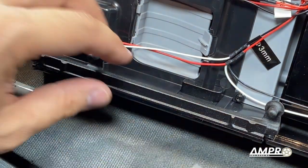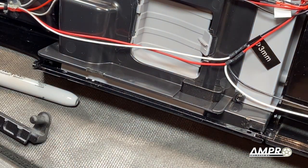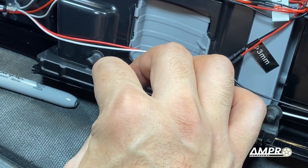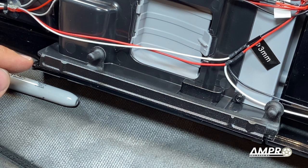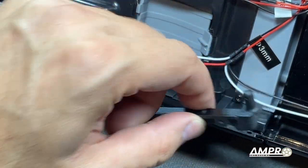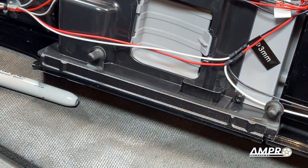I used this burr tool in this orientation — it was very, very clean and safe, and I was easily able to take an X-Acto knife and trim up the edges to make it nice and clean. I also wanted to note that I don't have this going all the way flush with the edge, and the reason for that is tires — I had a couple of other vehicles where they rub on an earlier variant of this. At the rear, you can see it hangs off a little bit but it's inset, and this way it gets a good mounting to the bed. You can feel free to install these with the same hardware that came off of the truck.